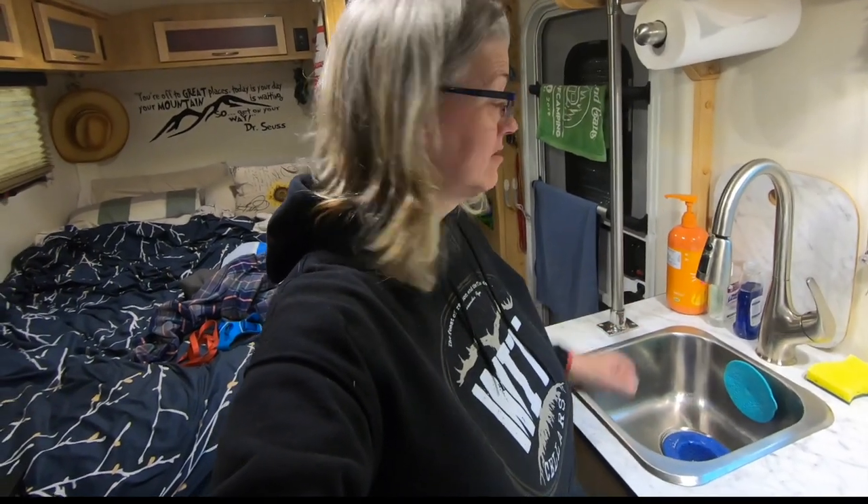Good morning! I'm going to flush the bleach out of our fresh water tank. Since we're in an RV park I'm not going to drain it onto the ground — I'll run it into our black and gray tanks and then dump it since we have a sewer connection right at our side. Open your taps and let it run into the gray, then run the toilet into the black. When the fresh tank is completely empty, I'll refill it and flush fresh water back through everything.